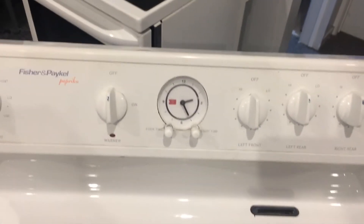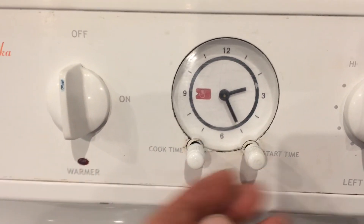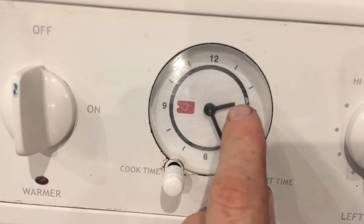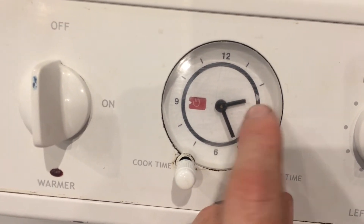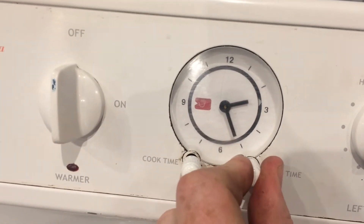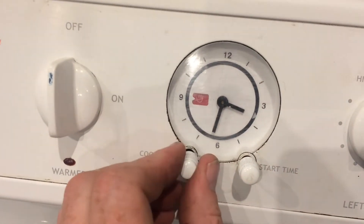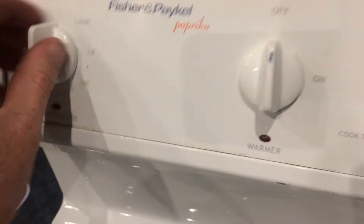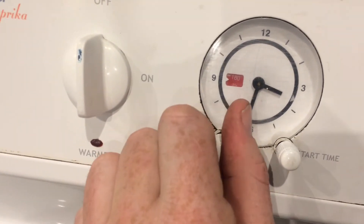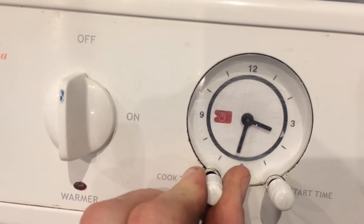You may also have one of the good old analog clocks. Most of these clocks are very similar — the Fisher & Paykel ones are all like this and the Simpson ones are very similar. You have a standard analog clock with two buttons that you can push and turn. There's a little window which could have a hand or various other symbols in it, and there's a third hand. When everything's working normally you have the hand symbol in that window, and as the clock rotates it carries the third hand with it. If you bump it while cleaning and you've got something other than a hand in that window — like an alarm symbol or a zero — it's not going to heat.